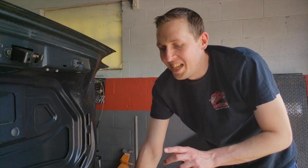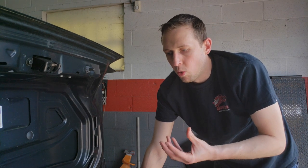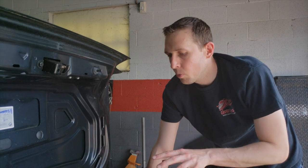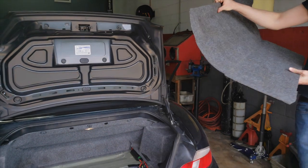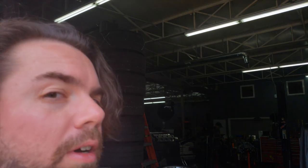The other part of the challenge is that you're really only able to prep one side of the metal, so you already have a massive burn-through issue where you're worried about blowing through that thinner metal. Technique-wise you have to have just the right combination of settings on the welder, skill in walking the puddle down, and wire thickness. And then you have the problem of not being able to have fresh, clean, bare metal — so you have a lot of contamination issues. Andy also had a little bit of stain remover and was able to clean up the trunk mat a little bit — that is good customer service right there.